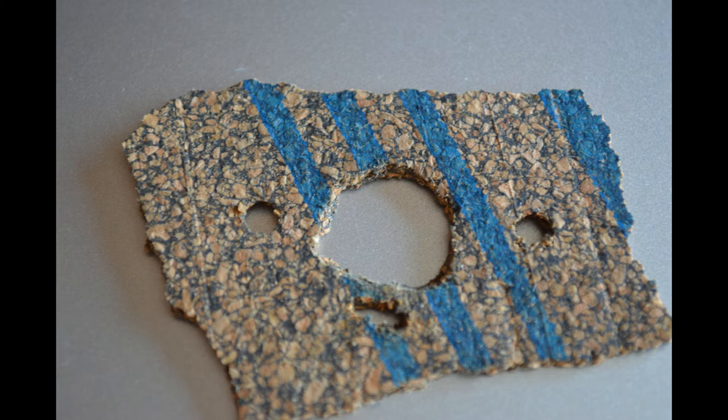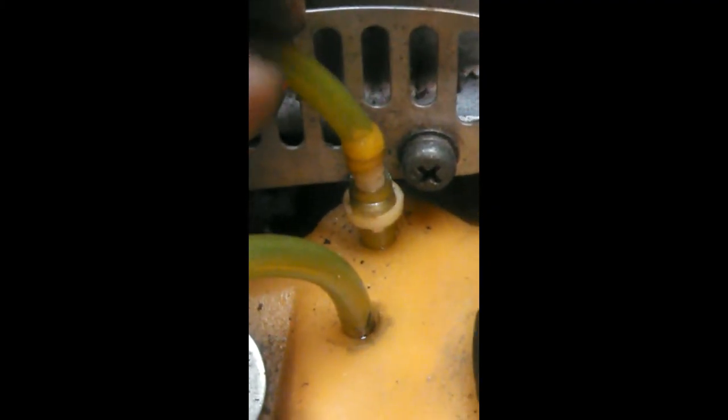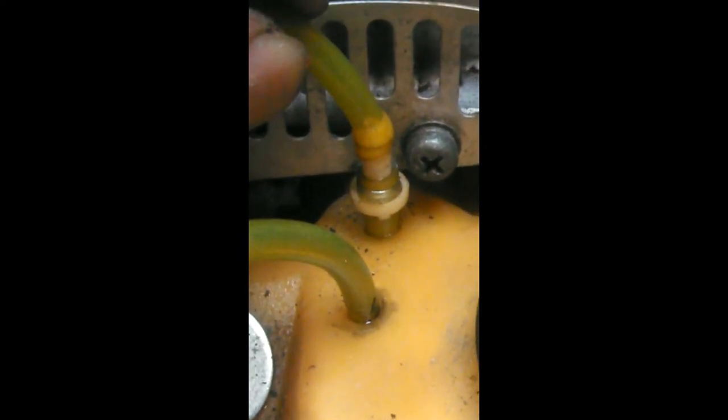Now with the gas tank, you can remove it. I did. It makes it a lot easier. Take a drill bit, which is 11/32, I believe. Don't quote me on this, but that is if you use the grommet. Personally, the grommets seem to last longer. Maybe it's just the gas, like everyone says, today's gasoline. But if you just shove the tube through a small hole that's pretty tight, within a year it dries pretty hard to where it almost slides like a trombone up and down.